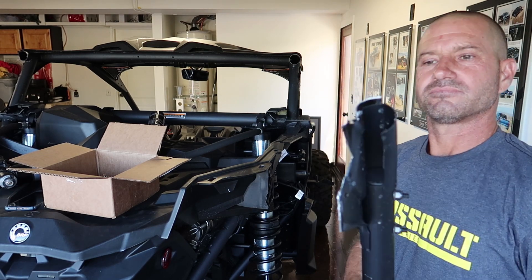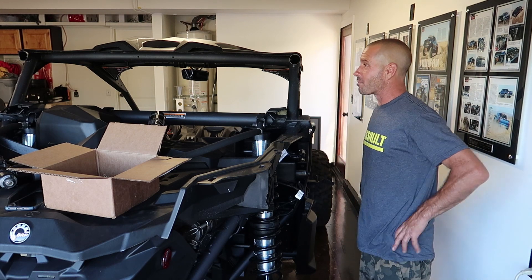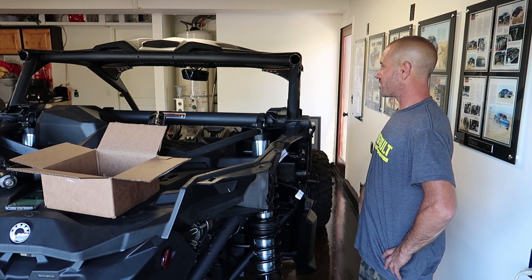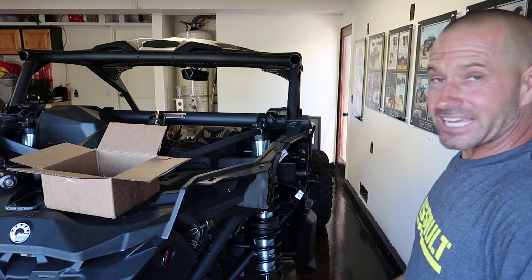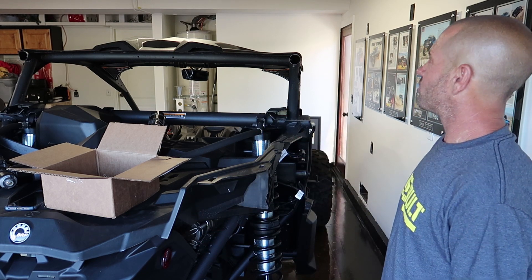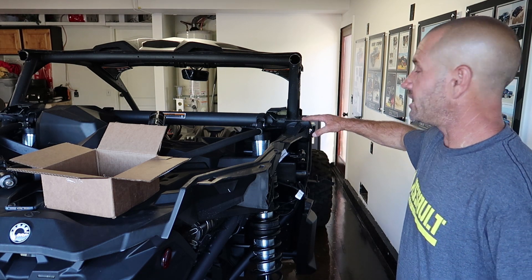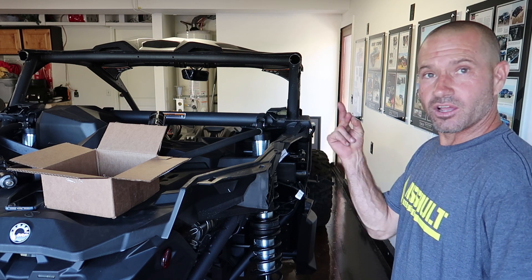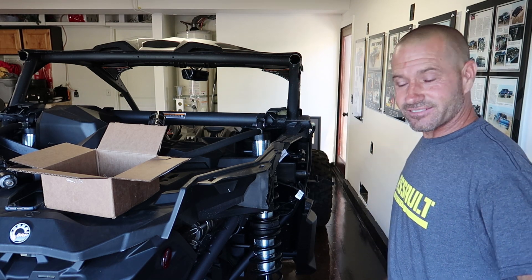This new cage is dope. All right, Eric and Janie, we've now built you a four-point cage — this automatically instantly looks better than the junk they already had. There's some black paint going on. Moving to the front now — pretty much all you have to take apart is the rear fenders, unplug the lights, a couple bolts and screws, lay the shocks over, slip the front end off, back it outside and cut it off, grind it, paint it, then wait for the new cage. Also drilling out the rivets on the suspension because the upper arms are going bye-bye too.